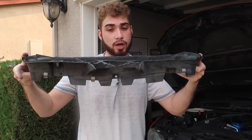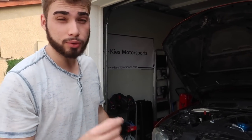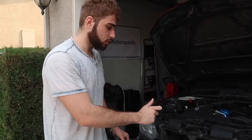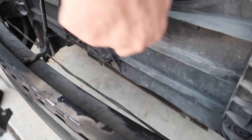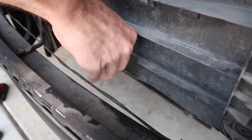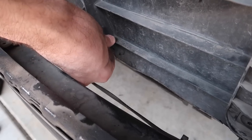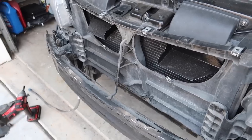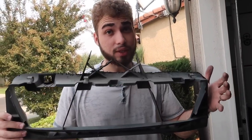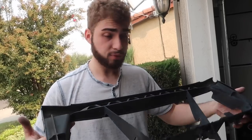This is what we ended up cutting out. The multi-purpose tool from Milwaukee — I mean, you can get any brand — but a multi-purpose tool is what you need for this. An angle grinder would have been super hard to get in there, whereas the multi-purpose tool just sticks right in. It made it really flat and looks super clean. Once we put back the piece that goes right here and then install the intercooler, you're not gonna notice any of that. Look at that — all one piece cut out. Pretty sick. Let's just put it in.